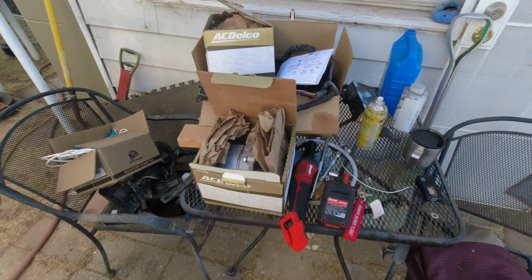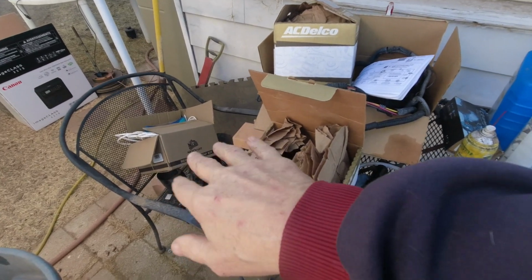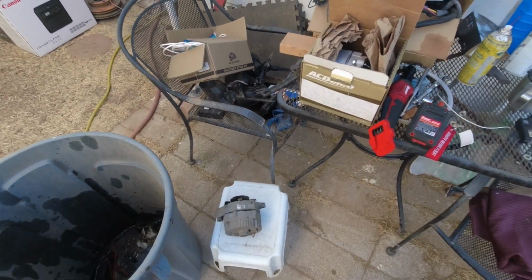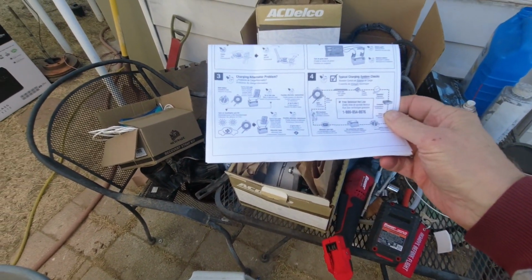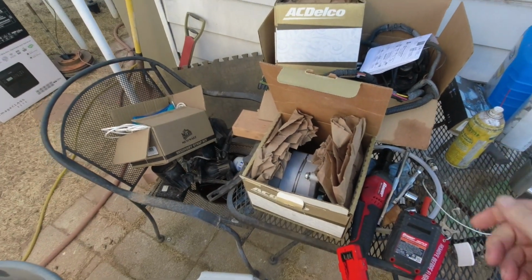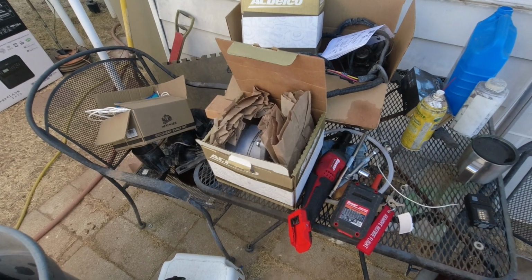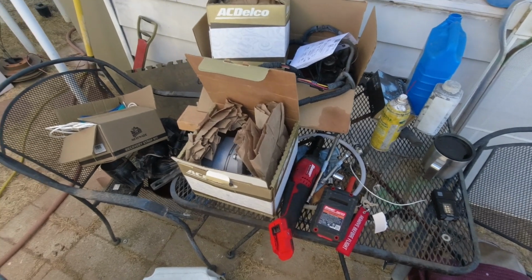All right, got the alternator, got my tools here, and I know what you guys are down there typing: but Chuck, just buy a new regulator and bearings for your own alternator. And yes, I could have done that, but looking at the instructions that came with this alternator, they think 15 volts is fine. 13 to 15, little smiley face. 15's not fine. 15's overvolting. Sorry. And the old one it's on is actually putting out 15.5. So no, that's not acceptable. But apparently they think it is.